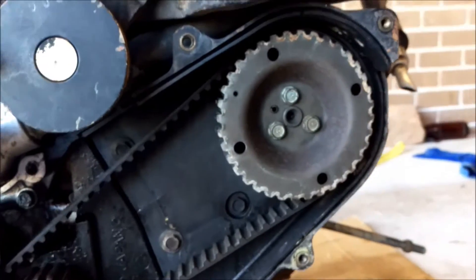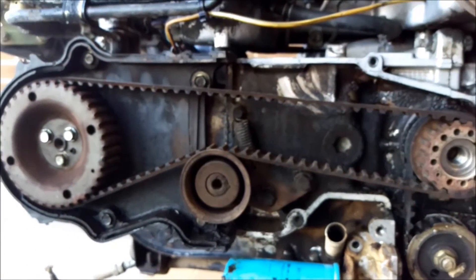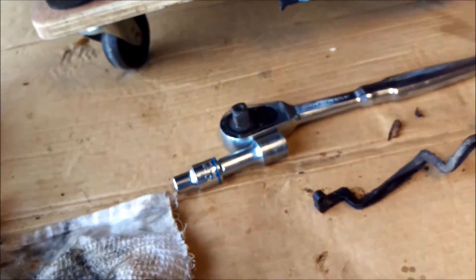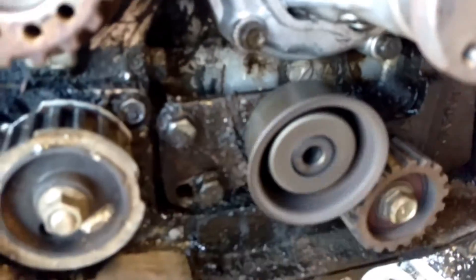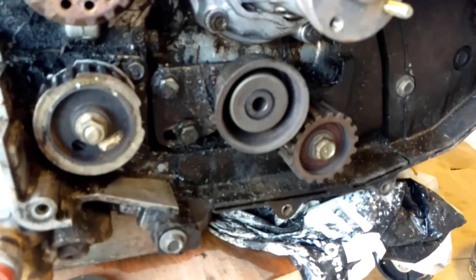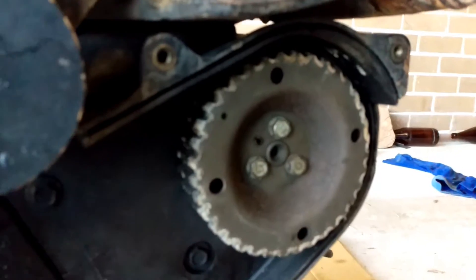If you take that off, it's going to spin because of the pressure on the valve springs on the inside against it, which means you'd basically have to redo the whole timing of the engine — so you might as well take that one off as well. I ripped off the cam or timing belt pulleys — both are a bit shot, a bit rigid and rattly and noisy sounding. This thing's going to need new ones. When I took the belts off, neither that, nor that, nor that moved — it did not rotate at all.